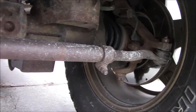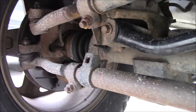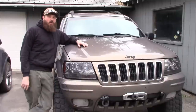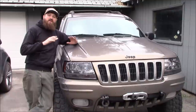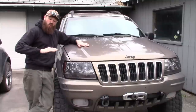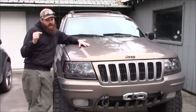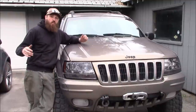The steering components on this Jeep from the factory are pretty big and beefy. The tie rod ends are pretty big, and the drag link and tie rod themselves are a pretty thick diameter. But this system is still all stock and I have reason to believe this might be the original components, so it's all worn out and loose. My steering just feels really loose going down the highway, and it's still a low-hanging steering system that has the chance of bending if I hit a rock or a rut off-road. So I want to upgrade this to make it bulletproof.